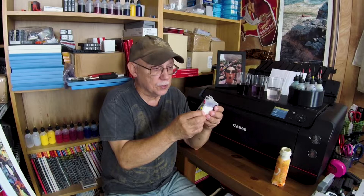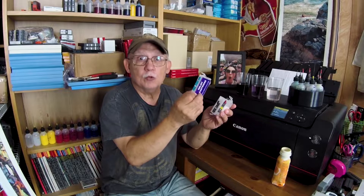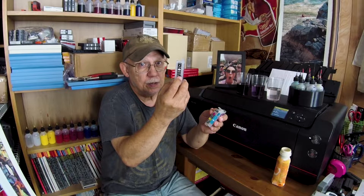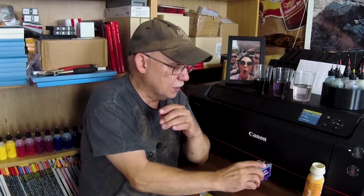What is it that they are reporting? Two things primarily. They identify the color of the cartridge — in other words, what color ink is supposed to be in that cartridge. So the chip on this yellow cartridge has an ID code for a yellow CLI-42 cartridge. This chip has an ID code for cyan for an Epson T159-2 cartridge. This one is for the R3000 and it says it's photo black — don't mistake it for matte black.